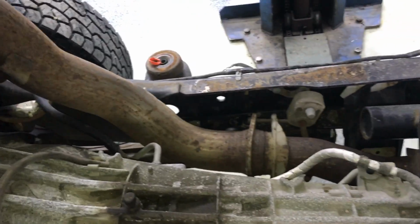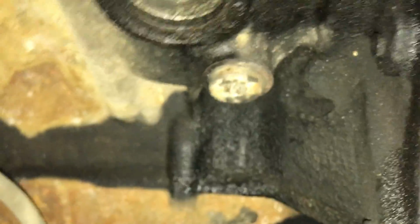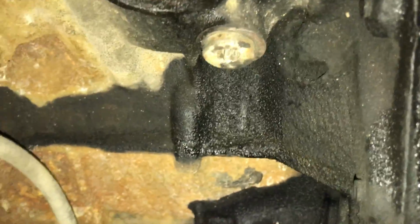Let's see, front crank seal. We're going to do the under cover harness. I'm just looking at all his flex joints. They appear to be all right. I mean, we didn't have a big boost issue going on with this, so. The dipstick looks pretty dry. It looks like the oil pan could have been leaking a little bit. We've got a little bed plate going on there. You see how it's wet along the bed plate? A little leaking up top too. Maybe, who knows? See how wet it is right there too? Could be the under cover harness leaking also.